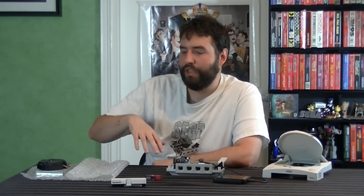However, there are certain benefits to doing it the way the GDMU did. Basically, the GDMU, as far as the Dreamcast is concerned, is the GD-ROM — it just is. The game folder is the disc, so the console is just straight up playing the game. There's nothing special going on as far as it knows. Whereas with this, the Dreamcast, as far as it knows, is running a game — that's what it thinks the menu is. It thinks the menu is a game. And then that game's code tells it to look on this device connected to it and run another game. So in layman's terms, the Dreamcast is running a game to run a game. And because of that extra step, it creates unintended bugs in the software. Some games will have extra issues that aren't supposed to be there, because it's not a clean boot.